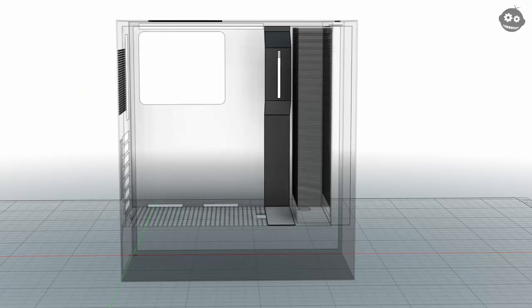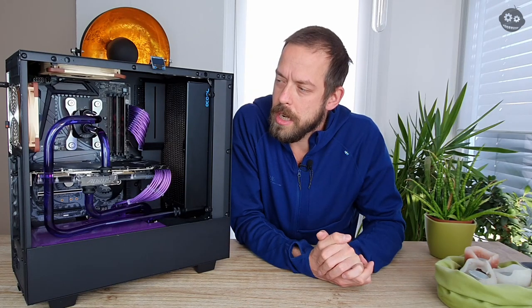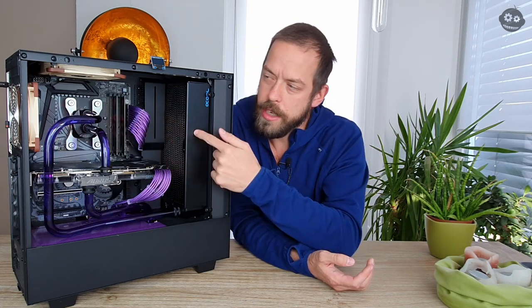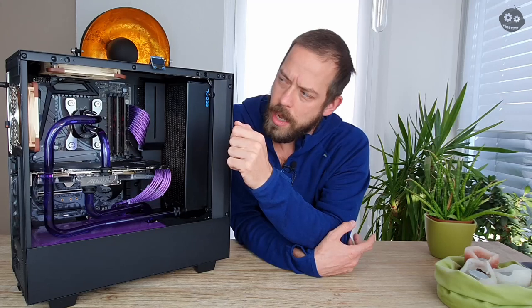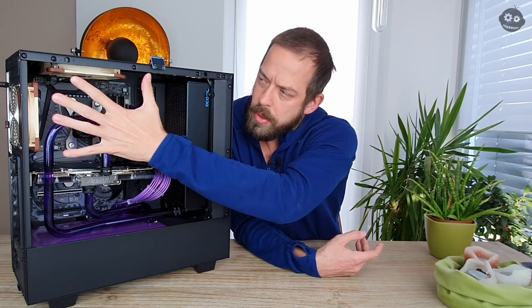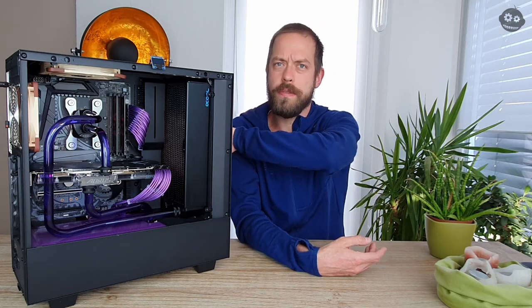You can see we are limited here by the small cover that hides the cables, so the biggest we can get in here is 60mm. I'm not having any fans directly on the radiator, so all the air is being sucked in here and here, and it's kind of being pushed into the case and then through the radiator out the back.